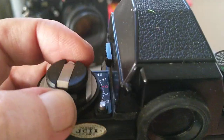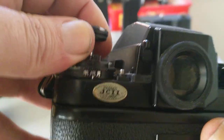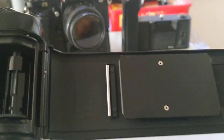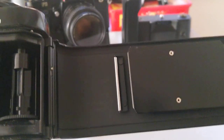The rewind crank for manually rewinding the film is a pull-up type with a lock on it. Push and turn to open — pull it up and the back swings open. There's a film reminder tab. This is the standard back, but there are interchangeable backs — a 250-exposure back and a special back that leaves the film leader out when using the motor drive.